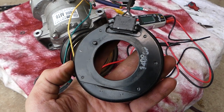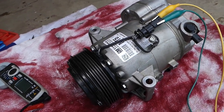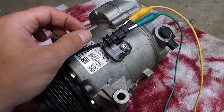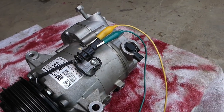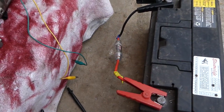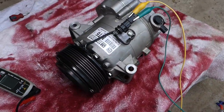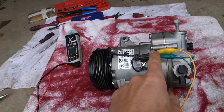Now, this is the test you shouldn't do — but it works. The black-with-white wire goes to the left side of the connector, and the all-black wire goes on the other side. We have a 12-volt battery with extension cables and alligator clips. We're going to touch the positive wire of the coil to the positive terminal of the battery, and the negative wire to the negative terminal. If you reverse the polarity or touch the wires together you will burn the clutch.